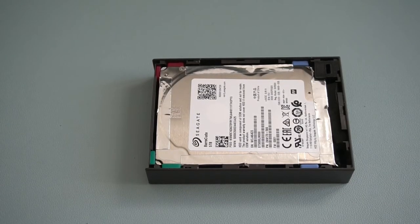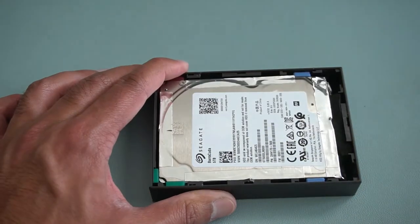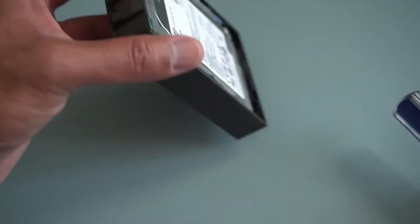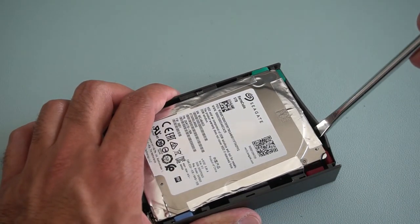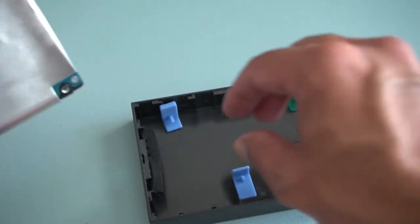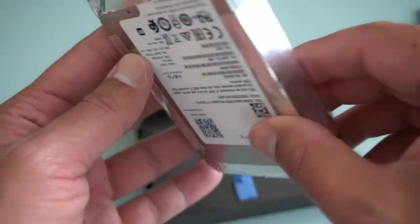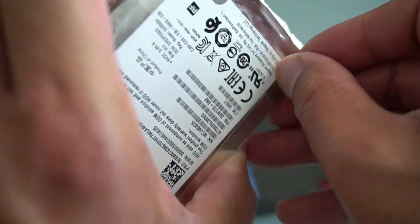It's much harder to take this drive out. There's a rubber tab here — let's take that out with a flathead screwdriver. It's just a rubber tab sitting on top of the light, not a big deal. I've seen other people take a screwdriver straight down here and lift it. And there we go — I'm just pulling it out without too much force. It's out! There's nice rubber protection in here. No screws, just little rubber grommets — it's a very nice design. Now we've got aluminium foil on the outside again.